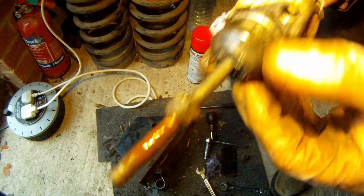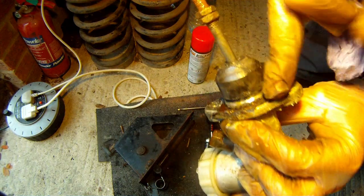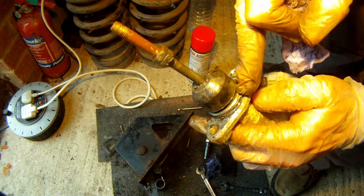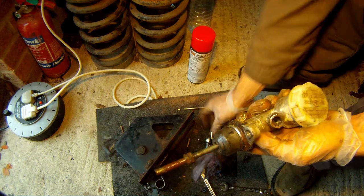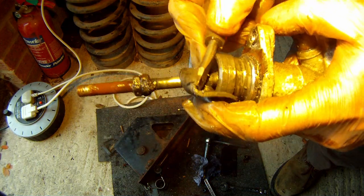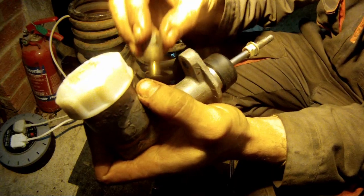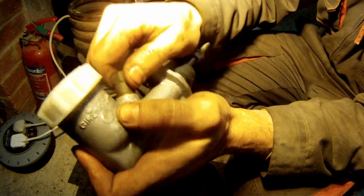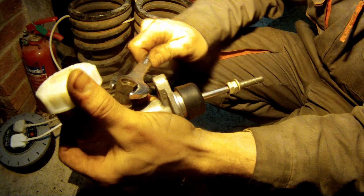There it is — it looks quite wet under there. There's a gasket that's supposed to go on here. Originally it was a metal gasket, but sometime around T5 I think they changed it to a fibre or rubber washer. I put silicone on here last time. Looking inside, that rubber's perished a little bit. The union goes on with a new copper washer — it's a 5/8ths — and just nip it up.